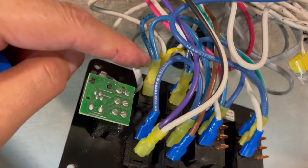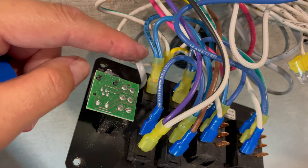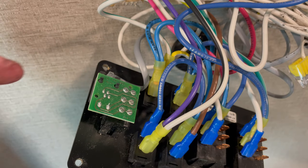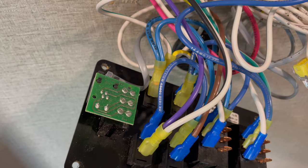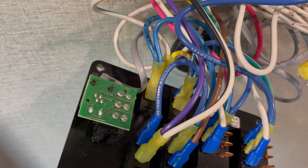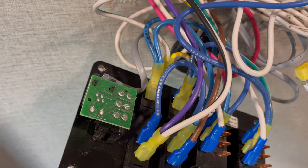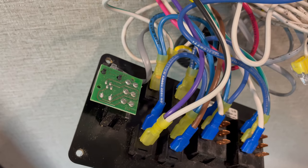We have identified the 12-volt positive wire as the blue wire. We know the N plus and the I connections on the Shelly PM1 connect to the 12-volt positive of the camper. Because the blue wire is the 12-volt positive, we can put a spade connector on a separate wire and connect it to the blue wire using the existing connector there. We then need to connect the other end of this wire to the push-in wire connector for the 12-volt positive connections.